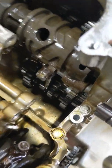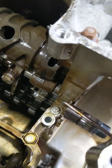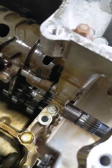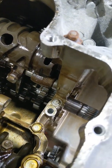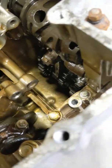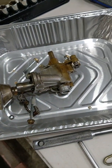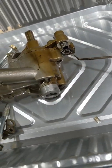With the oil pump out, pay attention to this oil orifice — it's very crucial not to lose it. I like to keep the same orientation it came in. I'll take all the dowels and O-rings out as they come along and keep them all together. All the parts go in their own tray — this tray is completely to do with the oil pump. I've got the dowel in there, the O-rings sitting there, so when I come to replace them it's simple to swap them out.